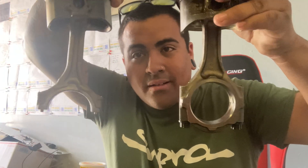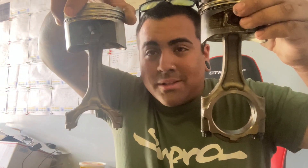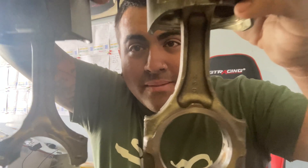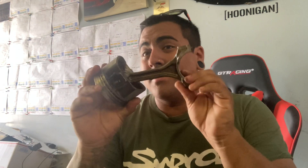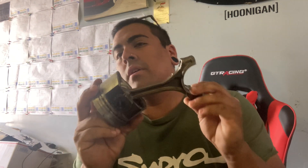To show you guys once more just how dramatic the difference is — just crazy, man. I'm going to quickly explain compression ratios and how much thinner these rods are and why you should not be running them beyond certain limits. We don't go over 14 pounds of boost really ever because it'll bend these. We have done 16 in the case of a super low mileage engine where the customer doesn't care. Where I like to keep all my NAT customers is 12–14 PSI, whatever it makes based on how healthy your engine is. This piston from a rod knock is actually in pretty good shape — nothing majorly wrong with it, the car just rod knocked.